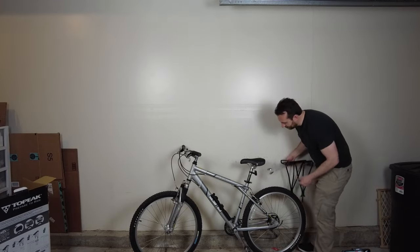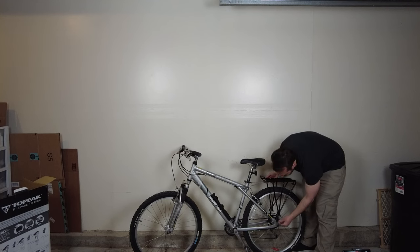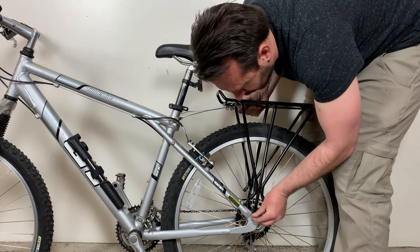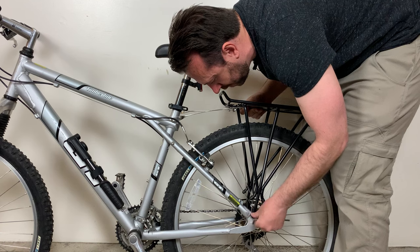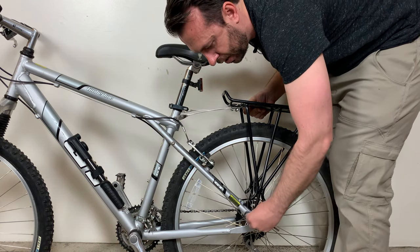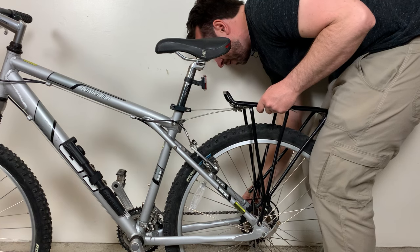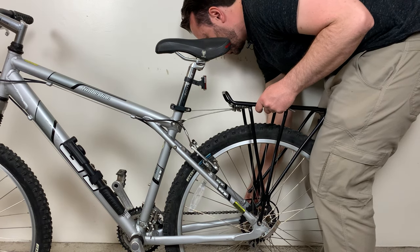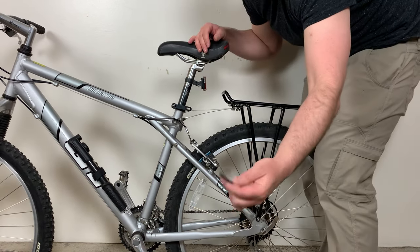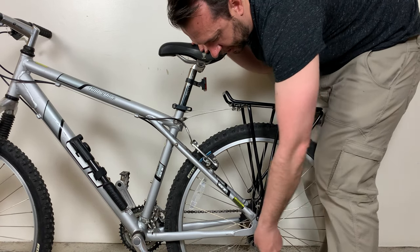For the back of the bike, it's looking for just a screw with a washer on it. Get it through the rack — and success on that side. Let's get the back side on here. Super easy to just twist it in by hand, tighten it as much as I can. Then I have a 3/16th Allen wrench that we are tightening it with. I'm not going to tighten it all the way — I just want to give it a little firm because I still want it to move a little bit.